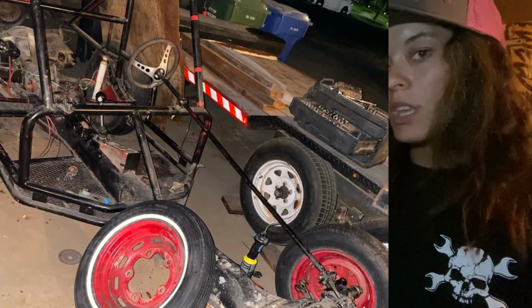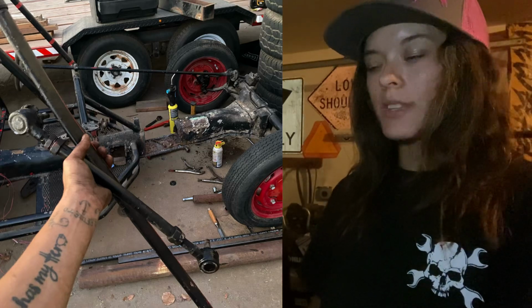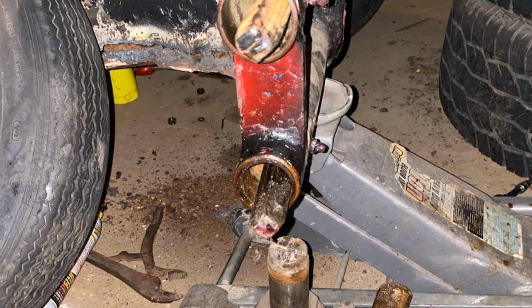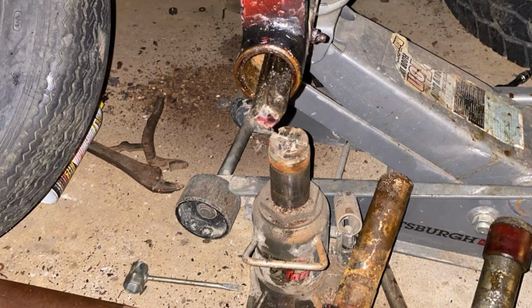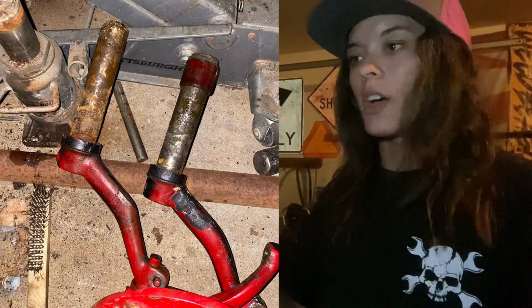I've worked for a couple hours tonight on the buggy. It needs a whole new front end, you guys. So pretty much this here is the buggy. It needs new tie rods, both the driver and the passenger. It also needs to be just cleaned out. Like, I'm talking like a broom to go into this tube, and the other side needs to come out. Everything needs to be cleaned out and sanded down, sandblasted, and all kinds of stuff. So that will be in the next video.